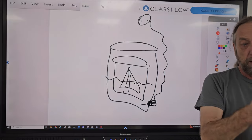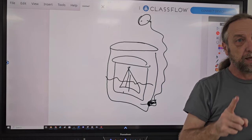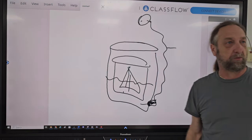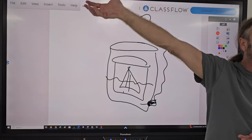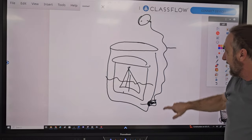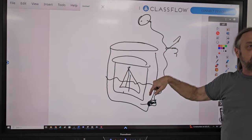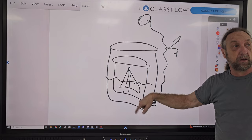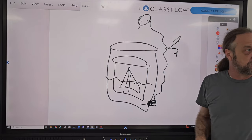So you put your hand around it and go like that, and you can cycle some of these switches. Now the thing was, they took a needle and put a little hole in the hose. So as it filled up, it had enough pressure to cycle the switch. But after a few minutes of operating, the air would leak out this hose and the water level switch would go back to empty position, and no matter how much water came in the machine, it would never go back to the full position because there's not enough air in here to cycle the switch.